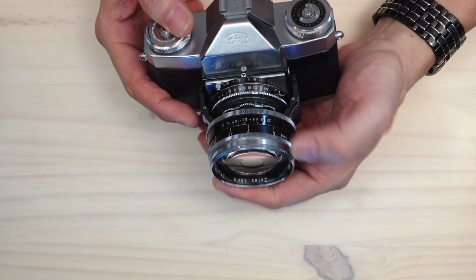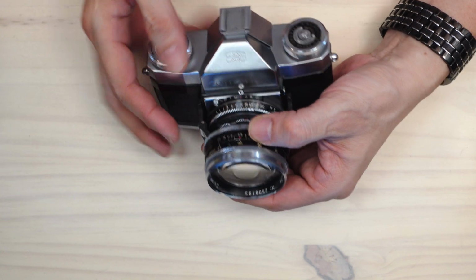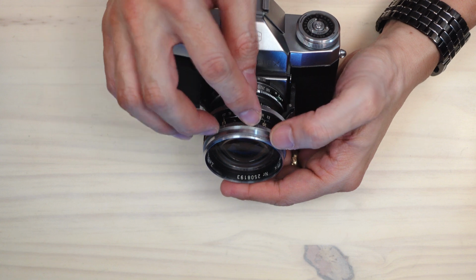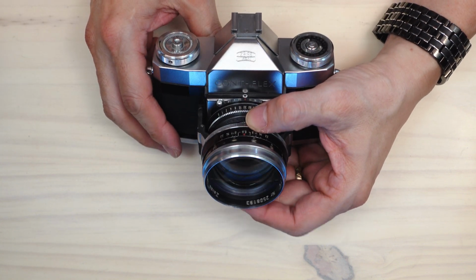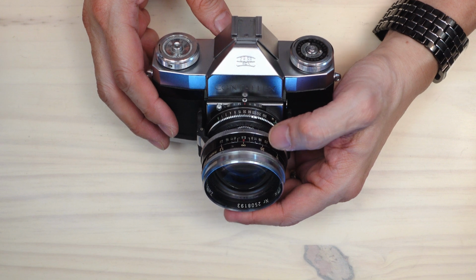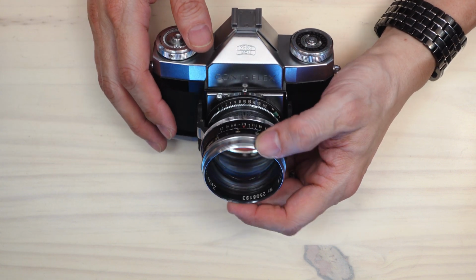Notice that this one is marked in feet and with meters on the underside. By loosening the screws here, there's 3 little grub screws, you could then take this ring and rotate it so that the meter markings was the default scale. In this case, though, I'll probably stick with feet. That's how the lens is marked, and that's actually what I'm most comfortable with.